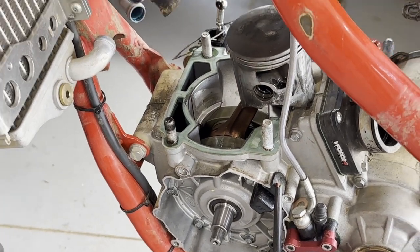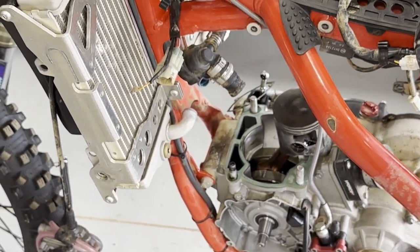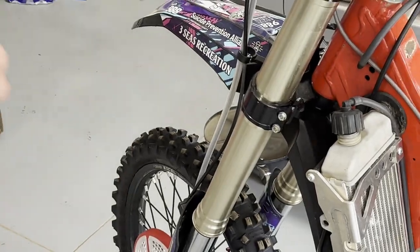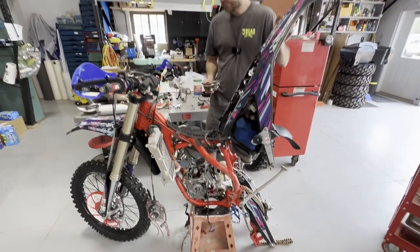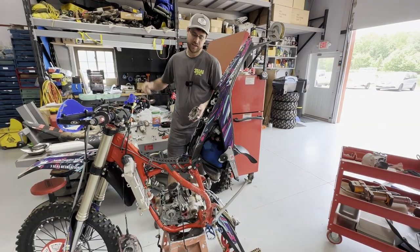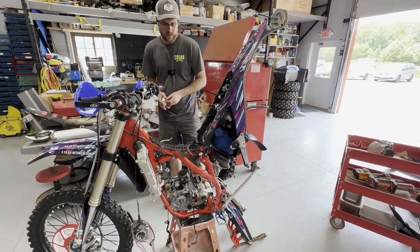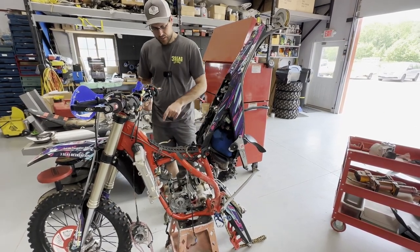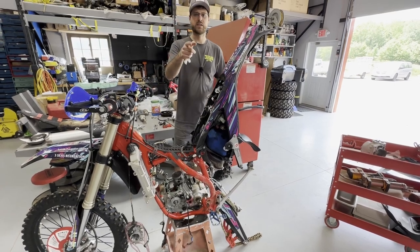I don't think heads are all that expensive — just put a new one on there. Matt isn't the kind of customer that's going to say let's save $5 — we're not going for that. I'm actually super impressed with how well this bike ran. The Penton was super muddy, and we've run a lot of really muddy GNCCs. In the heat of the moment when you're racing, it's hard to want to stop. Matt ran it until it was completely out of coolant. It did have under a hundred pounds of compression when I was trying to start it — still had spark — but the bottom of the crank is full of oil, so that's why it wasn't starting. We'll rebuild the bike for Matt. Thanks for watching, enjoy the ride.